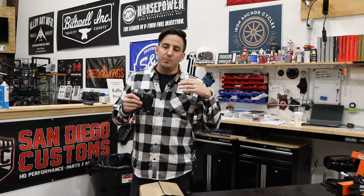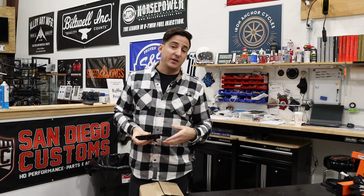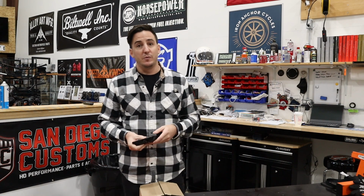And as the motors have gotten bigger and bigger, the breathers that exist on these motors, and have since, I guess, the 70s when the EPA started regulating this, are venting from the crankcase up through passages in the cylinders, into your heads through a valve, then out your heads and into your air cleaner. And that worked for a very long time, but as the motors have gotten bigger and bigger, that system just really isn't providing enough ventilation for these high displacement, larger motors.